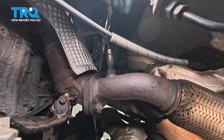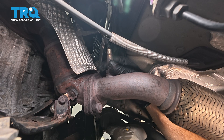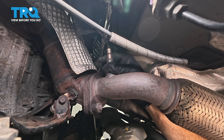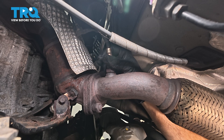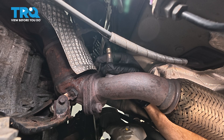Keep in mind that you have a wiring harness attached to this and it runs up and connects right behind the valve cover up in the engine bay. When you loosen this and try to unthread it all the way, it does have resistance from the harness up top wanting to twist it back, so just kind of hold on to it.